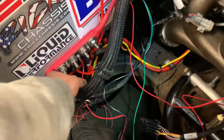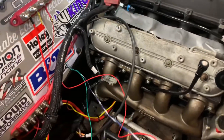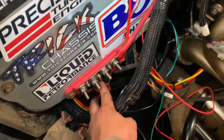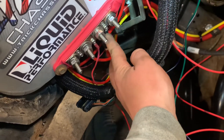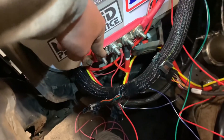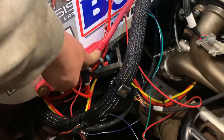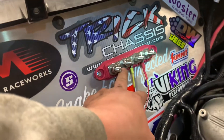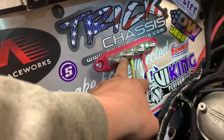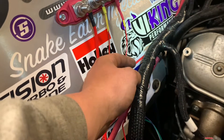So - there's power from the engine harness, power from the trans harness, this third little ring terminal is empty. This is power from the battery, this is power to the ignition, starter, and alternator. And then this is my ignition switch - so it's basically switched power. I have engine switched power from the harness and transmission switched power, red-with-white-stripe wires, which come out right here.